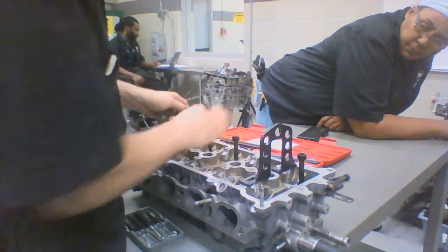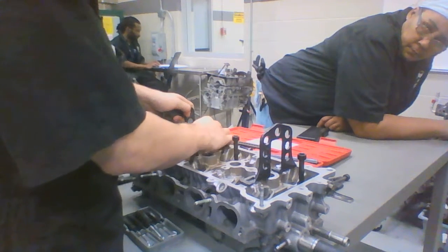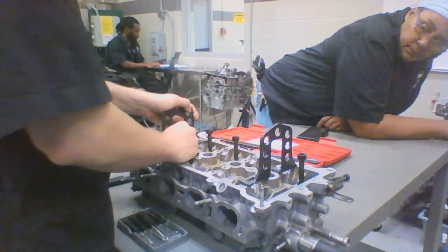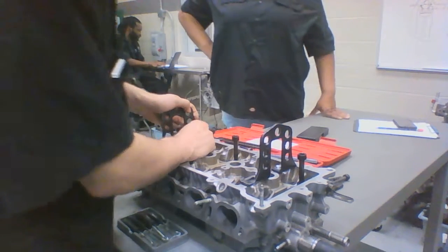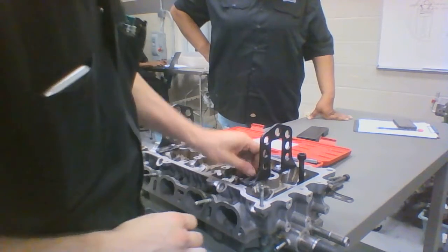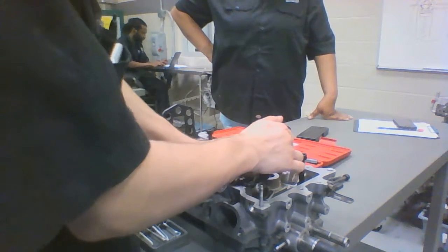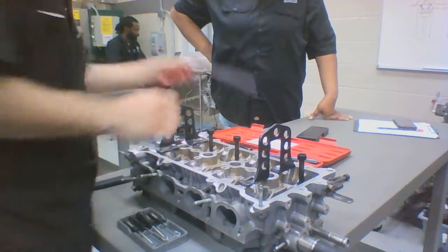Like for me, I also found the bolt to the shoulder, which is always preferred because they tend to be a little bit stronger. You guys making any progress over here? Possibly. You want to make sure that they're threaded in at least bare minimum a 1/4 inch. Otherwise, they are not going to have rigidity to actually hold still for what we're trying to do.